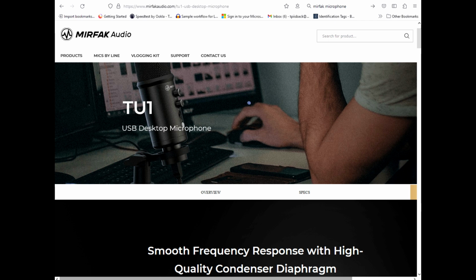And what I found with this is it may be fine for doing close up, probably 6 inches away from the microphone with the pop filter in front of me. It would be fine for that. But if you're recording music, for instance, you're going to hear some fluctuations and distortion to the music as the gate starts opening and closing, trying to filter out the noise. So use that when appropriate. I kind of like it just turned off like that. It's much smoother, but definitely with recording music, I would leave that off.